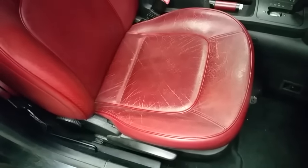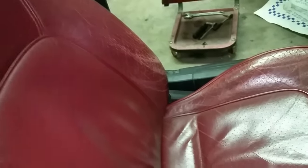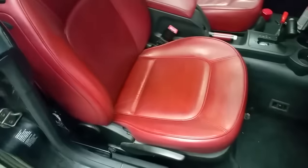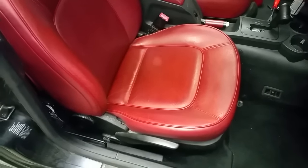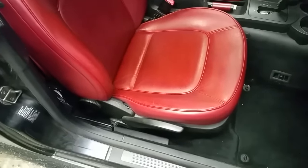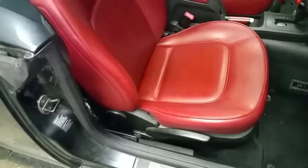I'll come back and show you what we did with the whole seat. Good luck to you. Subscribe if you like trick ways to fix things. There's the finished product. Now doesn't that look a million times better? Look how cracked up that is. There's the finished product, and we will do some sealer on it, some leather conditioner, and really make it look good. But that is basically bringing up the dye that's already in the leather with just a little bit of lacquer thinner and a little bit of closely matched red paint. That's it.